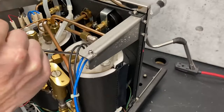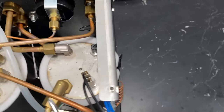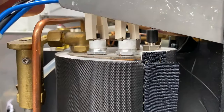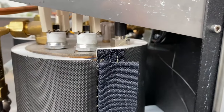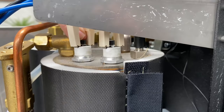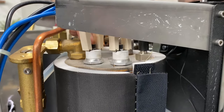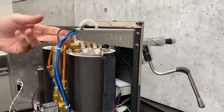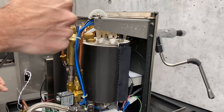Sticking to the brew boiler — you have your thermal limits. These are a safety on the top of your boiler. If it starts to overheat, it will trip one of these; they act basically like a breaker. If you're running through troubleshooting and they say, did you try resetting your limits? Look right at the top — there's a little black piece that sticks up. It'll always have a little bit of wiggle to it, so if you see it moving around, that does not mean it's tripped. If you push down on it, you'll feel a very light tactile click. One is for the load end and the other is for your neutral. If a boiler is not heating and you're not getting any error messages on your PID, that's a good place to check.